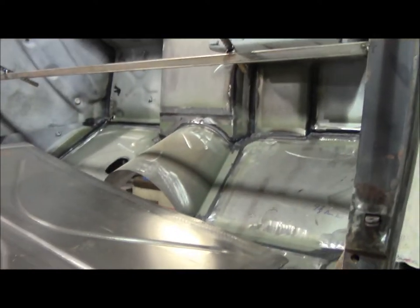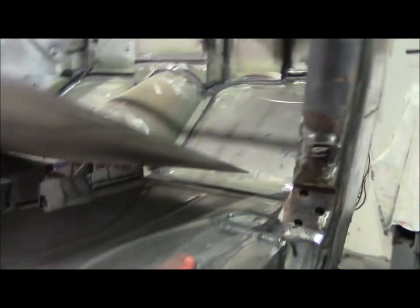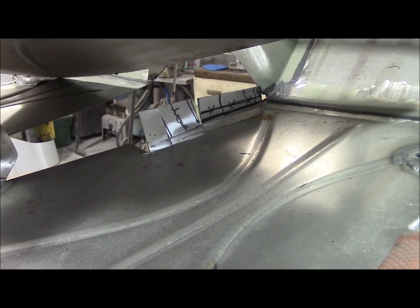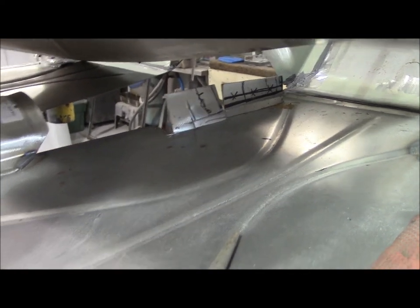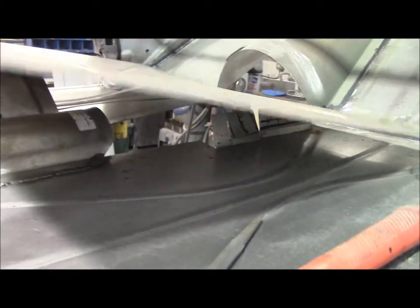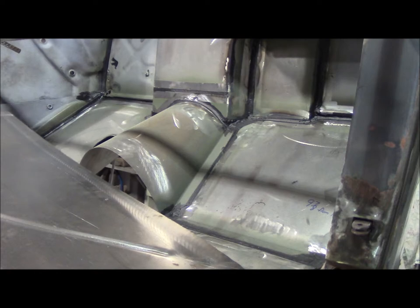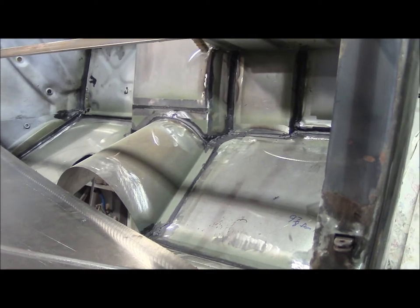Everyone's got their own way. You can see we've got all the front floor pans in — she's looking good. We've got the metal cut up right here with some markings because that's where the emergency brake is coming through, so I've got to modify the floor there a bit. But we've got the front panels all in. We've had the car up and down several times on the hoist and they're lining up beautiful, absolutely perfect.